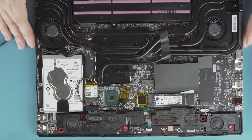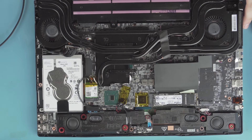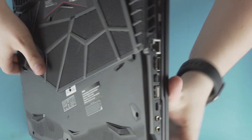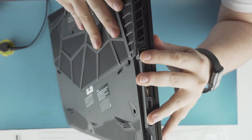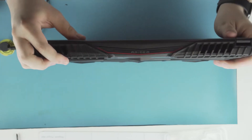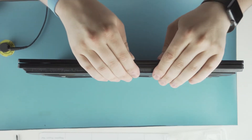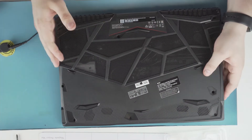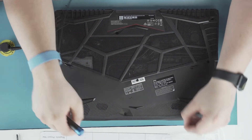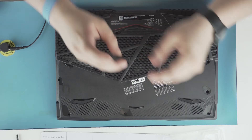And that's about it for this unit — no board flip, nothing is underneath there. So we've finished installing all the upgrades. We're going to go ahead and throw our back panel back on. Audio ports are going to be the most important part to clip in first. Slide the ports in, then make sure all the clips are closed — no seam. Now let's put the screws back in; screws are all the same size. One particular thing you can note is that you can reset your CMOS battery right here with a small paper clip — press and hold for a few seconds. That's an option you can do without having to take the back panel off.